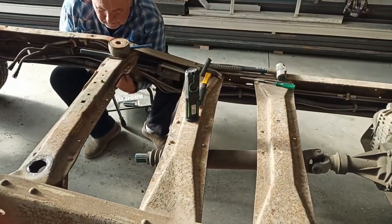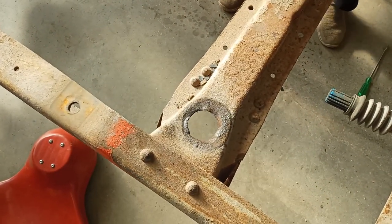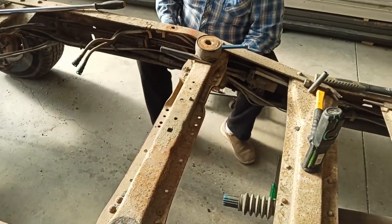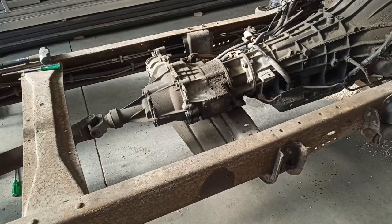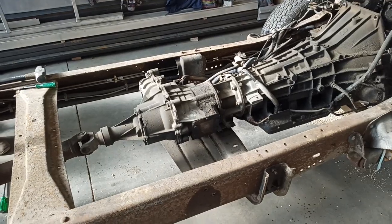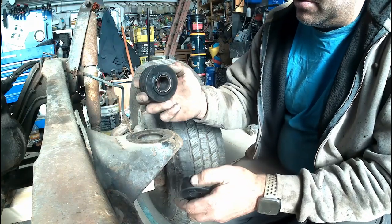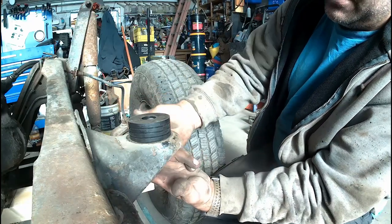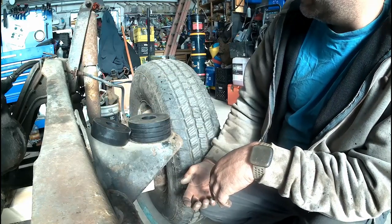John's working getting the last of the rear cab mounts out here, and I'm not sure whether I'm going to rework these or what. They're needing a little bit of attention probably here, so get going on that. And then just a bunch of cleanup and make the lifts and start putting her together. These ones are pretty simple, just Energy Suspension skid there. One sandwich between the top and the bottom, and away a guy goes. So we'll put those two in and then start seeing how I'm doing the rest.